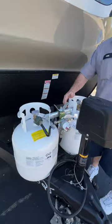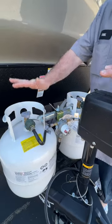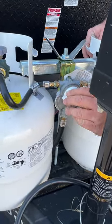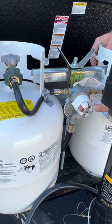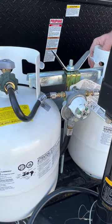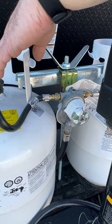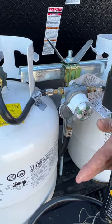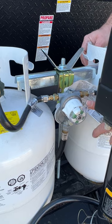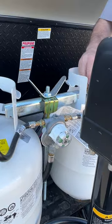Next, we're going to have our propane tanks. You have two 20-pound cylinders. These guys have both been filled, minus what was used to test the propane system. This here is your regulator. It tells you which tank you're using with this little notch. As you see, it's showing red — that means no propane flow. If we turn this guy on, it just flipped to green, telling us we have propane flow. This is designed so you can have both tanks on. Once the one tank it's pointing at empties, it will start going from the other tank. You won't know that unless you come out and see it reading red, showing that tank is empty. We usually recommend one tank at a time.